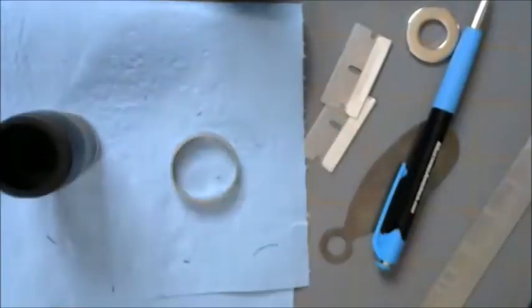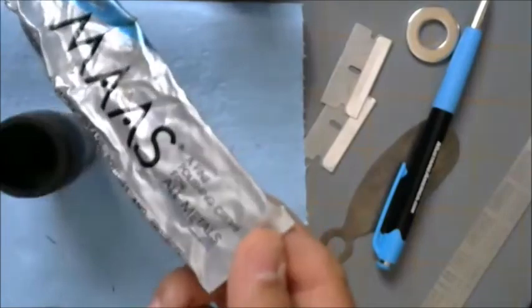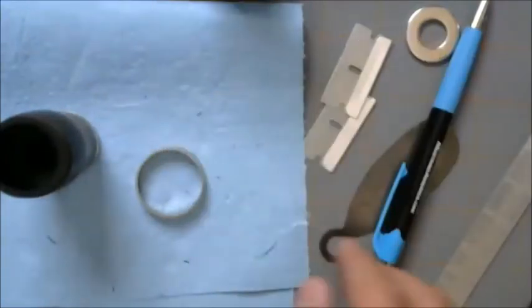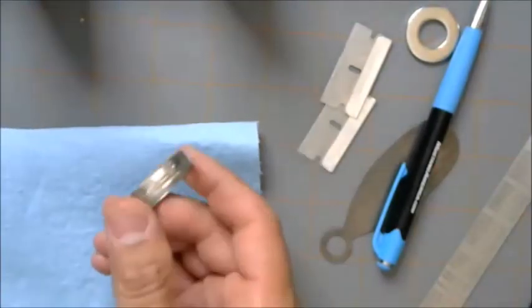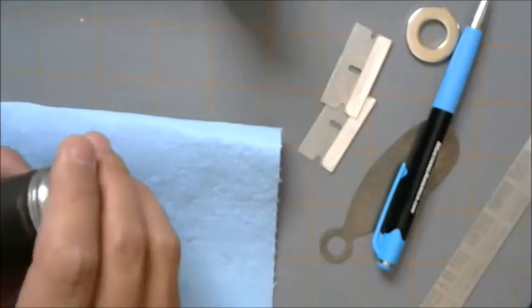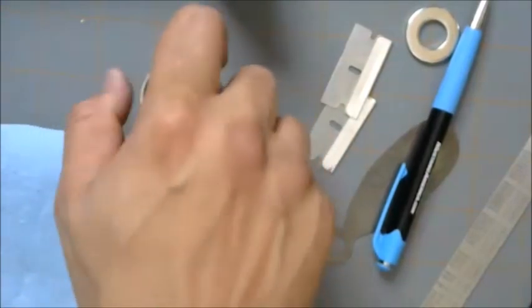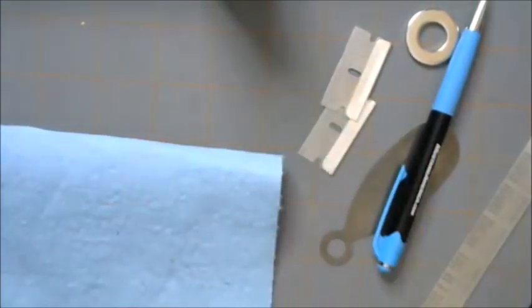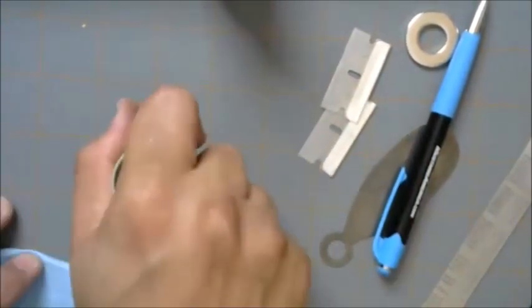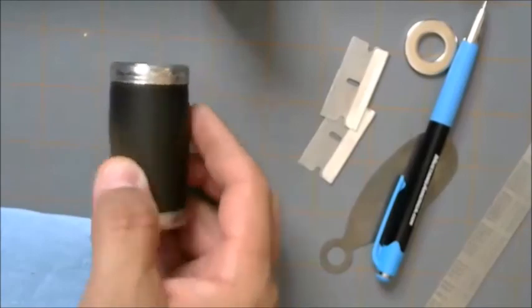After this point, you can clean it. We'll be showing in a later episode how to clean rings and stuff. You can use stuff like just metal polish. And that'll clean up just good. This one isn't very dirty. Putting it on is fairly easy. Make sure you got the bevel on the inside. And then just tap it down. Voila, it's back on.